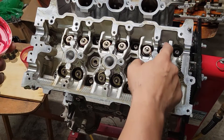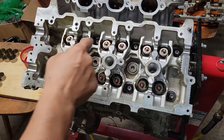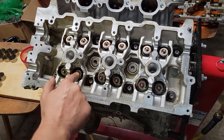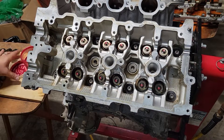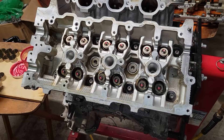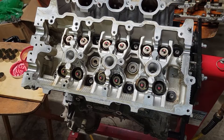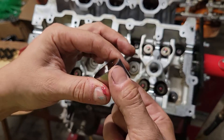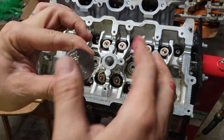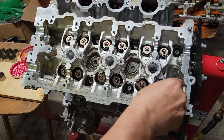What I'll do first, I'll put a little dab on the end of the valve stems. It won't take long. Once the engine's oiling system is primed, it won't take long to get oil up to everything. We have all these followers, we have them all oiled down. But what we'll do is clean them, wipe them with a dry rag, and put some of this assembly lube on them. It doesn't take a whole lot. And put them back in the same spots they went in.